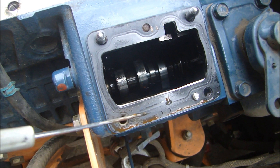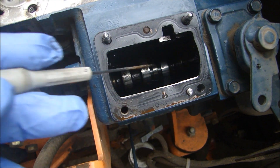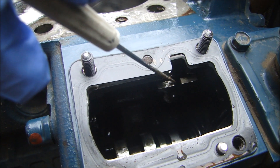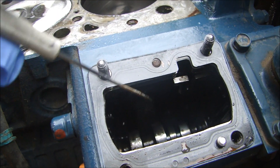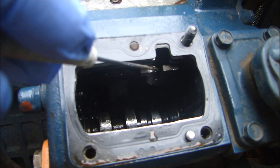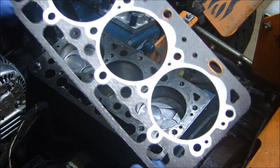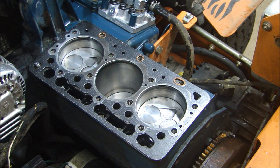Here's what it looks like inside where the injection pump goes. You can see the cam in there — three lobes on the cam that drive the lifters up and down. Inside here is a little shuttle that goes back and forth, and this is what the pump engages with when you put it in. There's a little spring on the inside that pushes the shuttle — you've got to be mindful that this engages correctly into the shuttle. With the pump ready, the pistons and head deck are cleaned up. The head gasket can really only go on one way — there's a hole on the end that has to go towards the locating pin. Set the gasket in place and put the head on.